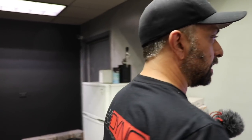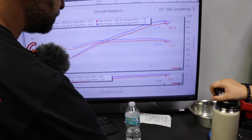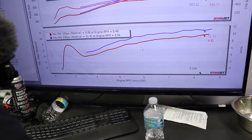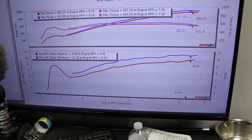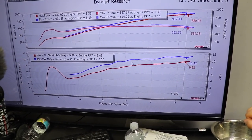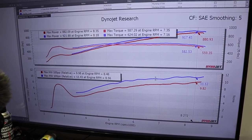That 3.3 pulley is always kind of questionable on a 6-rib, but it might have held. Let's take a look — that's 12 feet, is it? Yeah. 11.5 pounds. Right here in the mid-range it's up a little less than 2. And right here — is that slip? It's hard to say, it's a little bit wavy. But anyway — 921! That's awesome.